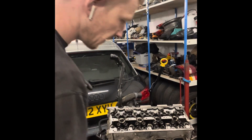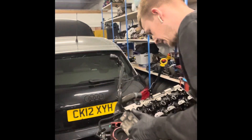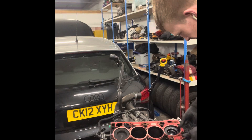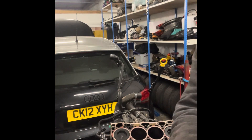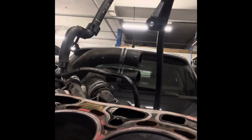The head's about to come off. Cylinder one is measured at 3mm lower than cylinder four. Better not put the head on the floor because the glow plugs are hanging out. I'm smiling because I'm happy with my diagnosis — not happy that I've got to give someone a big bill. You can see that cylinder four is protruding and cylinder one sits underneath.